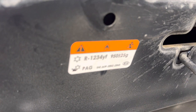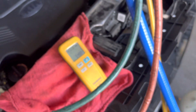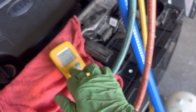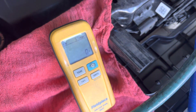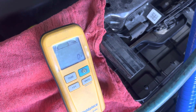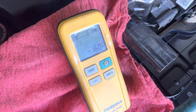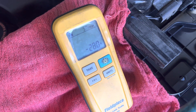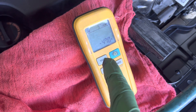Let's turn on the Bluetooth and sync up to our scale — syncing up now. Zero it out — it's zeroed. I'm going to open up the liquid line on the liquid side and we're waiting for 950 grams. We're filling up now. On a dual-system SUV, 950 grams doesn't take long.